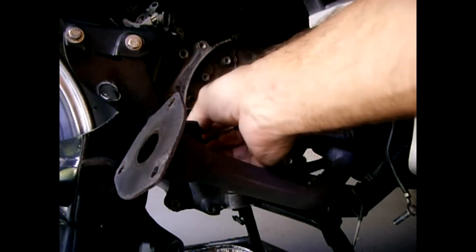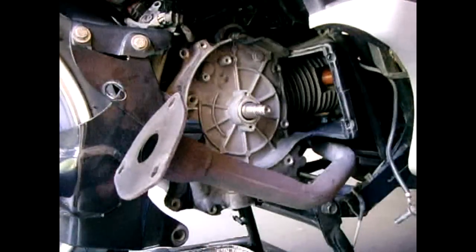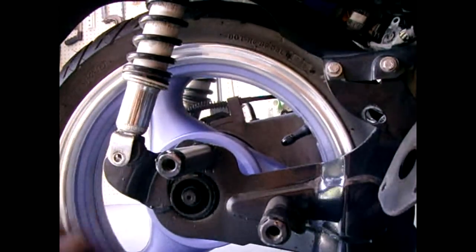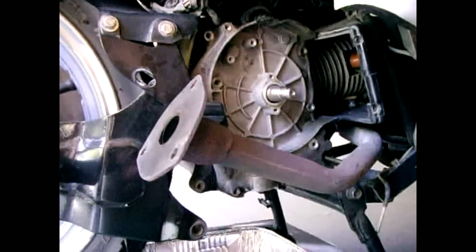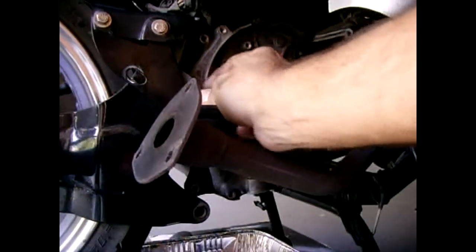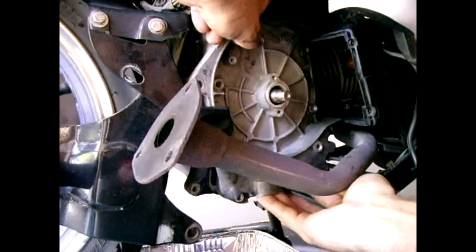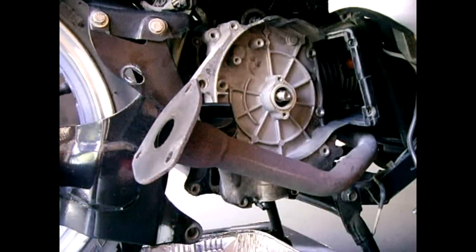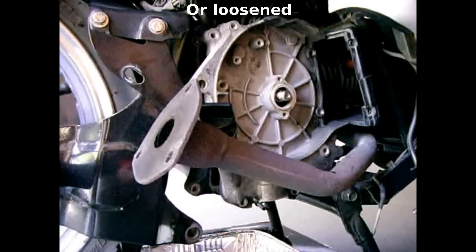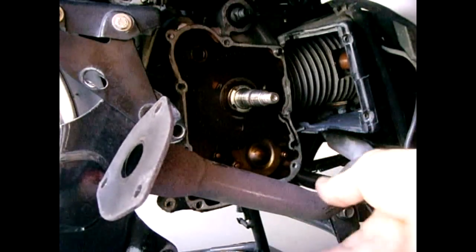You're also going to remove the shock. The bolt here has been removed, which allows this plate to move around freely. This plate was normally up here not allowing you to pull the cover off, so it now drops to an area where the cover can be slid forward. Once the pipe is loosened, the entire piece slides off and we can access the oil pump as well as the starter gear. The cover is now slid off — I was able to leave the pipe on, just loosened it up.